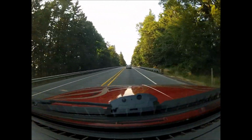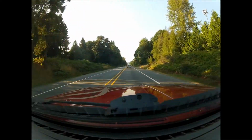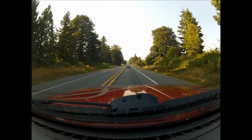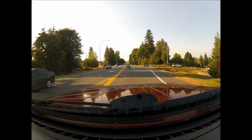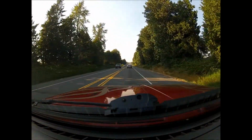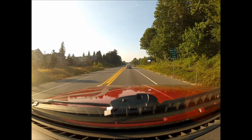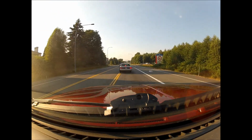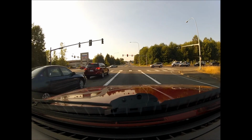Holy. Those old tires have to hunt back and forth to keep her straight. This thing's just going nice and smooth. I'm impressed. You know, those Swampers are good off-road, but boy, they are a lousy road tire. She still pulls when you're under braking, though. That could be grease on that one rear end too, pulling everything to the left. It's that right rear that's leaking still.